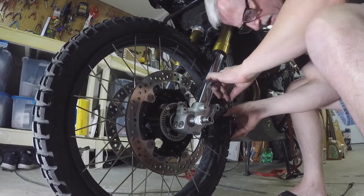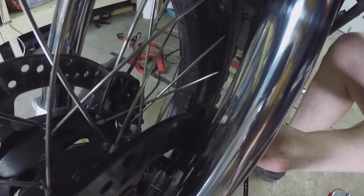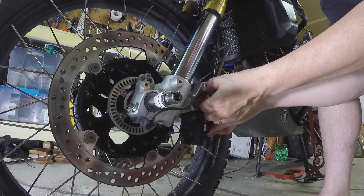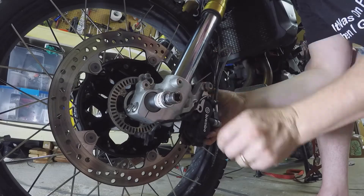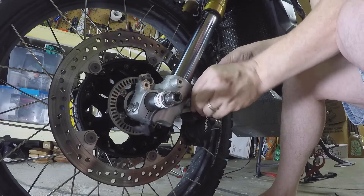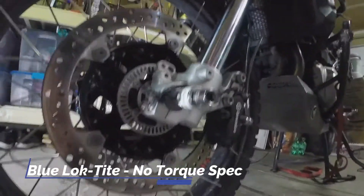This is a little game of getting everything to line up all at the same time. The biggest hassle is the rotor, so put it on the rotor first to give yourself an advantage, then work your way towards getting those bolt holes in the right location. Don't forget that this clip has to go on here because it holds the ABS cable piece in place - that's got to go in first. Then find that hole - there we go. I'm going to put these down hand-tight, just barely snug.